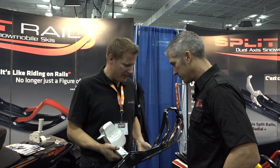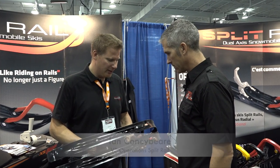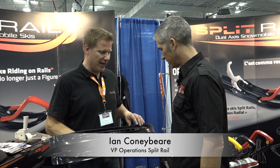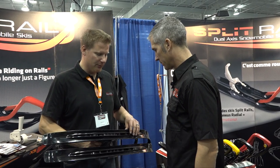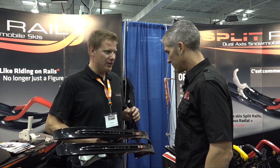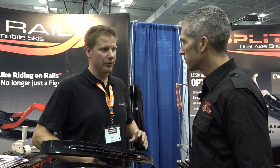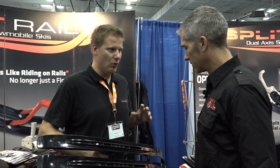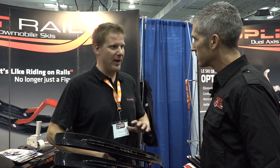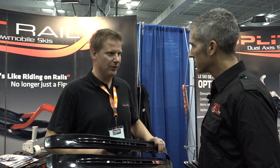So this is a split rail ski — a split ski. It's got two rails, two separate rails on each side. The first thing you notice is it doesn't have a keel going down from the center. It basically runs as a flat bottom ski. Without the keel there, there's nothing for the ski to sink down into when you're driving straight, so there's no way for this ski to dart at all. It actually planes up over the top of everyone else's tracks and will never sink back down into any other tracks. So it'll just keep tracking straight and true.